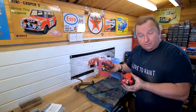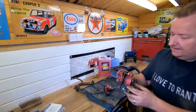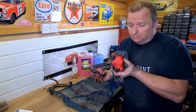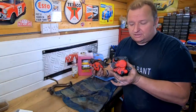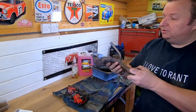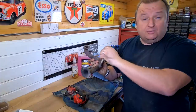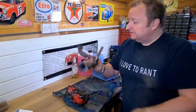Right, I finally got them off — that front wheel one was a right pain. I had to loosen the wheel off and get the disc off to slide this one off, but it looks like something's been leaking there. They need stripping down, getting the powder coat, and hopefully I can get the seal kits for these. I tried typing in TGB R50X brake kits on eBay and Google and couldn't find anything, so we'll have to see. That's the exhaust manifold coming off, and there's that pipe — it goes up to some sort of system with a rubber hose connected to it. I think that might be to do with keeping its performance down so I'll possibly be blocking that off — I'll just cap that.